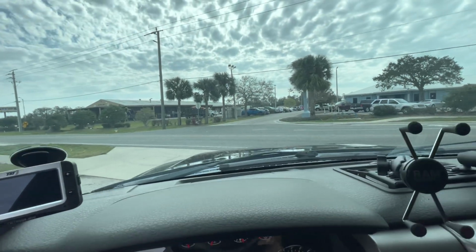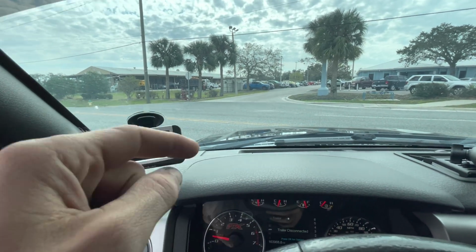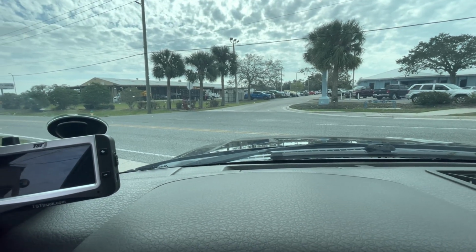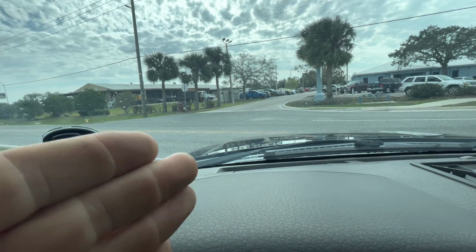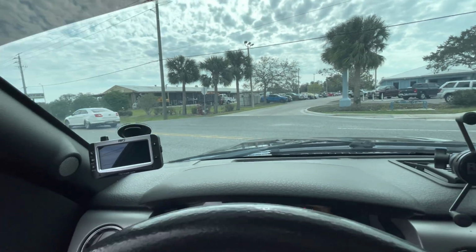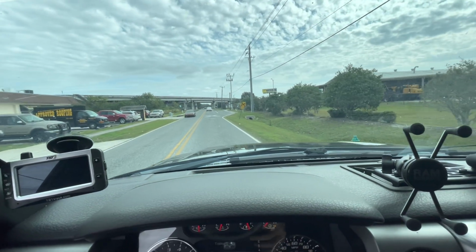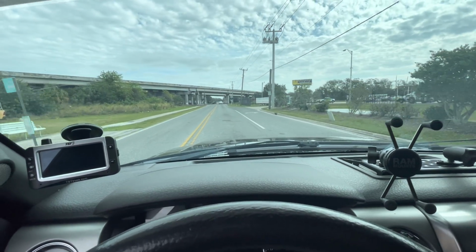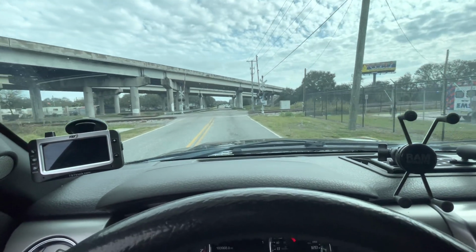Now I believe that this truck came factory with 373 gears, and I put in 456 gears, so that's a lot deeper of a gear ratio. I'm curious to see how this thing performs. I can't get on it and ride it out to its fullest potential because there's supposed to be a break-in period. You have to take it very gently. I'm basically headed out just to check for noises and things of that nature. I believe we're in good shape, but again, we have to take it very easy. Not supposed to get the gears super hot or put a huge load on them, which we are not.